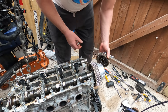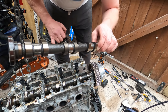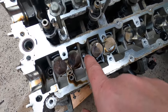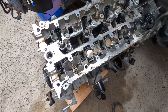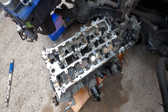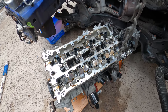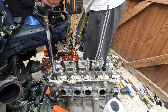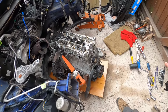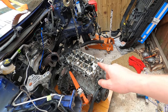Stuck in with the rubber, but there it is — the cam's out. You can see there are ten head bolts, five each side. Normally you'd undo them in a sequence and I'm going to kind of do that to some extent, but overall I'm not really going to care — just get the head off. Every bolt is out. I'll give it a tap with a rubber mallet — it should pop off and we should get to see what's gone wrong in number one cylinder.